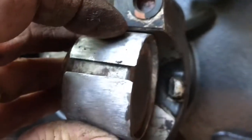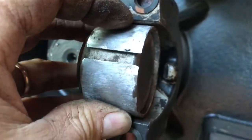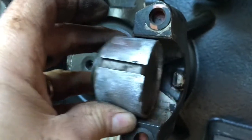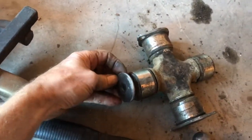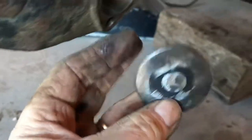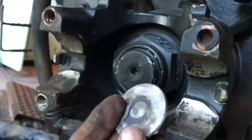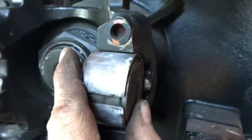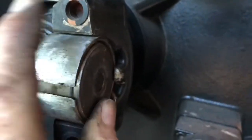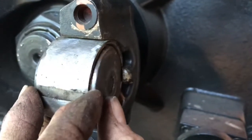When I put my clamps on, it will clamp it down. The second problem is the distance — when I put the actual u-joint in, I've got a gap in the end length. So I took the caps, busted a cap off of an old u-joint, machined it down with a cutting torch and a grinder since I don't have a lathe or machine shop, and made a shim — basically a washer. That will go in here to take up the space, and I'll put a tack weld on both sides to keep it from flopping out.